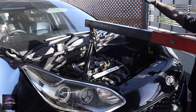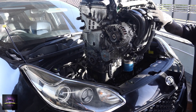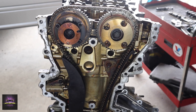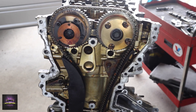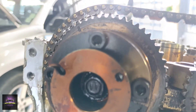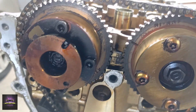Three days later — I got the okay to pull this engine out and break it down. There's the engine coming out. The customer said do what you gotta do, diagnose it, and give me an update. Look right there — the tensioner basically failed, it's sticking. That caused the timing chain to slip, timing to jump, and the valves came into contact with the pistons — and that was it. I need to discuss with the client whether they want me to rebuild this engine or get a replacement engine. Until next time, take it easy.